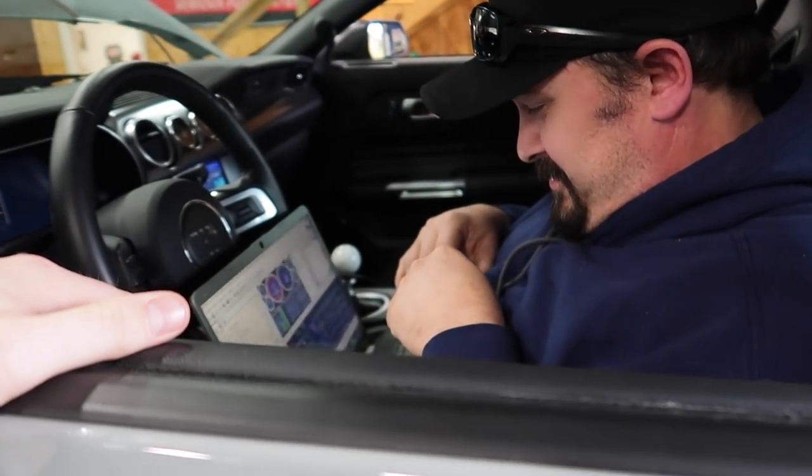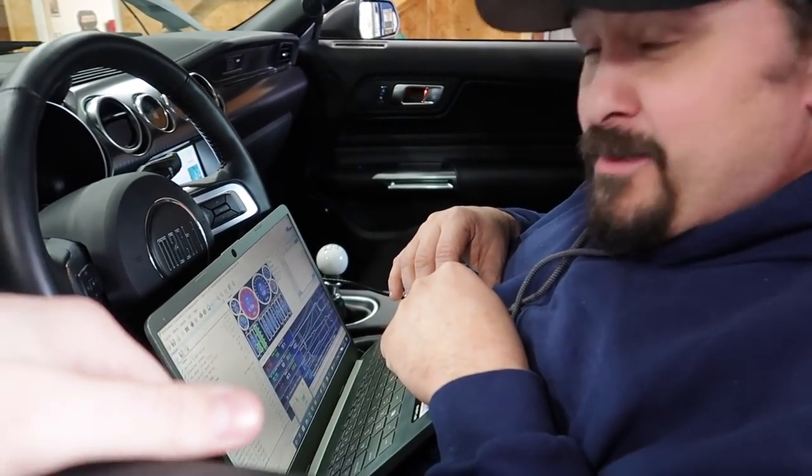We did 461, and then 735 today. So we picked up 274 horsepower with this supercharger kit. That's freaking nuts. The reason I wanted this car on the dyno before and after is that this is my first ESS kit, and I wanted to see what the supercharger picks up. The only way to do that is put it on the dyno, put the kit on, bring it back to the same dyno, and run it again. 735, a gain of 275 horsepower, on 7.5 pounds of boost.